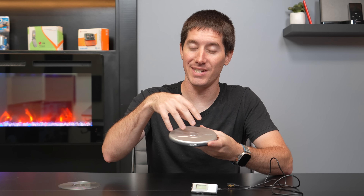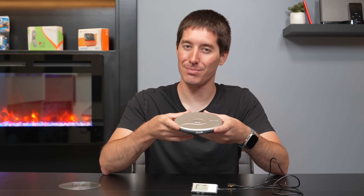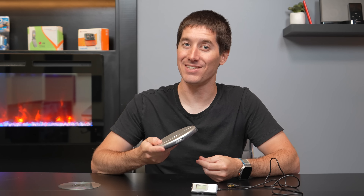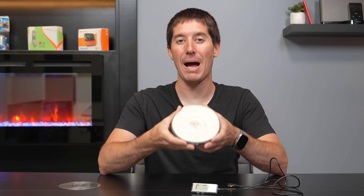It acted like a computer because when you put an audio CD in it and started playing it, it would spin it up at incredibly high speed and buffer the entire thing for anti-skip. It had 180 seconds of anti-skip memory — that's three minutes, basically every normal song. It would load the whole thing into memory and stop physically spinning the disc, which gave you a bunch of battery life. This thing had 23 hours of playback time — incredible, as good as the iRiver T9 MP3 player, and this had to run a motor and spin a disc. It had eight minutes of anti-skip protection when playing MP3s or WMAs, saving multiple songs in memory at once.